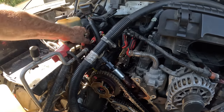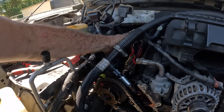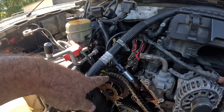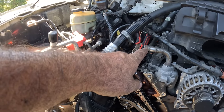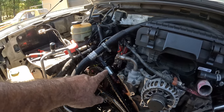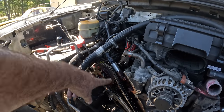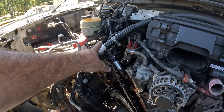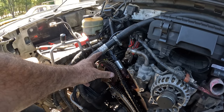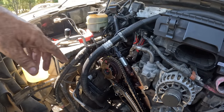You can just pinch with one, roll with the other, just so you're rolling it, not losing your camshaft. And what I mean by losing your camshaft is the valve springs and lifters, because there's pressure on those lobes. If you had nothing holding it, it'd want to roll over as soon as you take the chain off, just so you can hold one vice grip, move the other vice grip, roll the cam a little if you need to, and that way you get your timing right without taking all your valve train off.